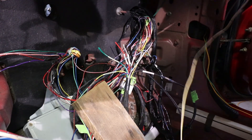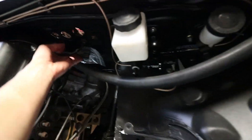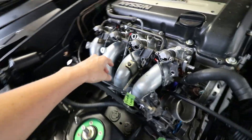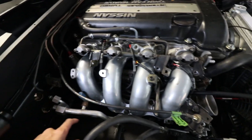I didn't have a stock harness so I went ahead and bought a new harness for this. We've got everything wired up for the engine, minus the MAF — because obviously there's nothing there now — the O2 sensor, and the boost solenoid. We just ran everything under and through the intake manifold here. We're getting new injectors because we just broke one today — oops, that was my bad. I've got the fuse box, everything plugged into the fuse box. I've got the SR20 fuse box that came on the Wiring Specialties harness tucked up next to it.